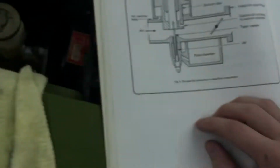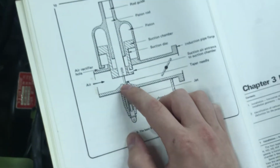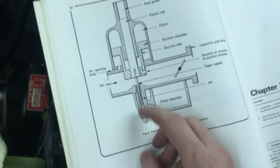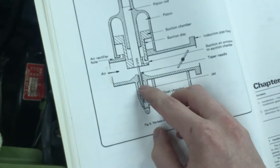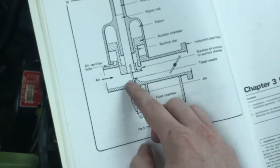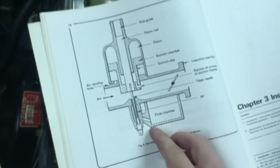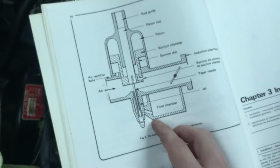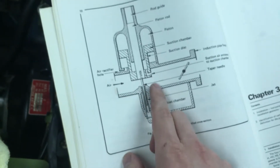But at that point, that needle is all the way in there, meaning that it's so wide that little to no fuel could theoretically pass by if it wanted to. Whereas when this piston rises all the way up, maybe this part of the needle is actually right here, meaning the opening, because it's skinnier all around it, because it's a needle, a 3D cylinder, there's a lot more room for fuel to pass by, meaning that your mixture is going to be a whole lot more rich because there's generally a constant level of airflow within here.